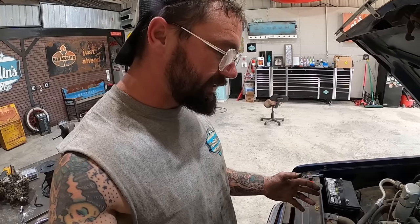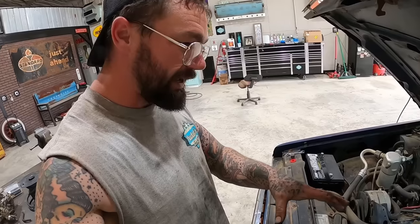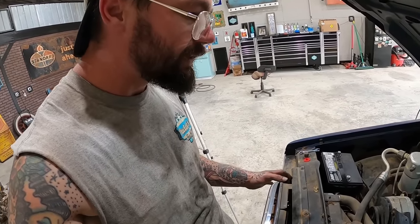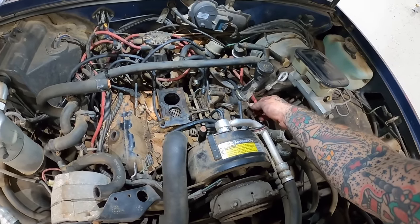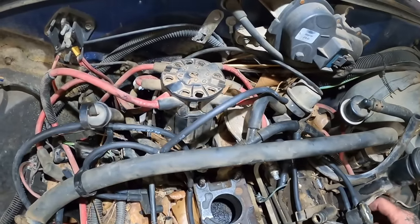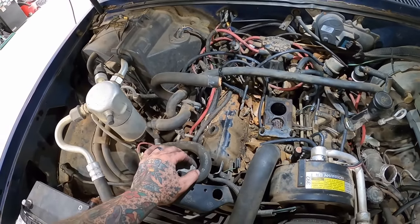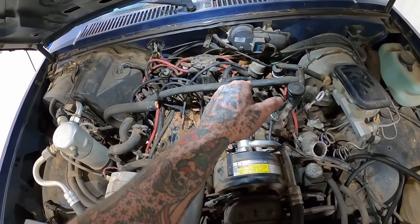So what I learned was, because I want to pull that distributor cap, not the distributor, where I can kind of see what vacuum lines are hidden behind that. We're doing a tune-up on this thing anyhow. So I was like, where's number one? So just assuming, I started wiggling on this right here. Maybe you can see that's moving number two. Ah, number one's going over here. So on a 2.8 liter, we've got 135, 246.